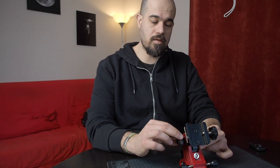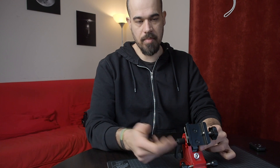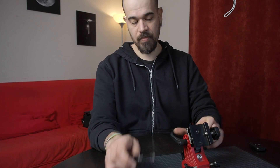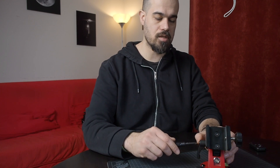Instead of doing that, many people try to over-tighten the lever — with the result that they break it. The lever is made of plastic and the handle can snap, or like in my case, it just keeps turning because of a broken piece inside the lever mechanism. This is annoying because I cannot unscrew it easily to replace it. So I have to disassemble it — I want to replace this lever with a metal one that I bought from Amazon, and I will put the link in the description below.